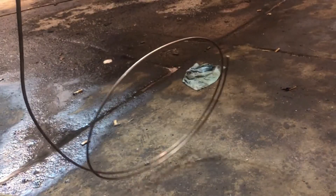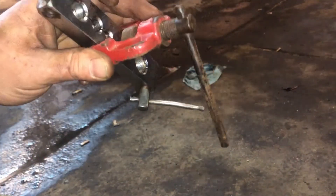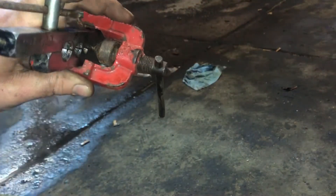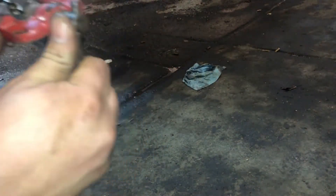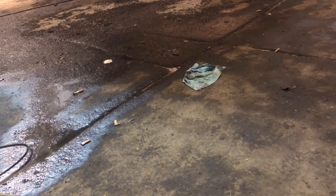We've got a chunk of brake line here, and I've got my fitting on the brake line slid back. Here's a little tool — you just clamp it in the 3/16 spot. This is a regular flare so we use the point and tighten it down to make our flare. Stick the brake line out of the clamp just a little bit.